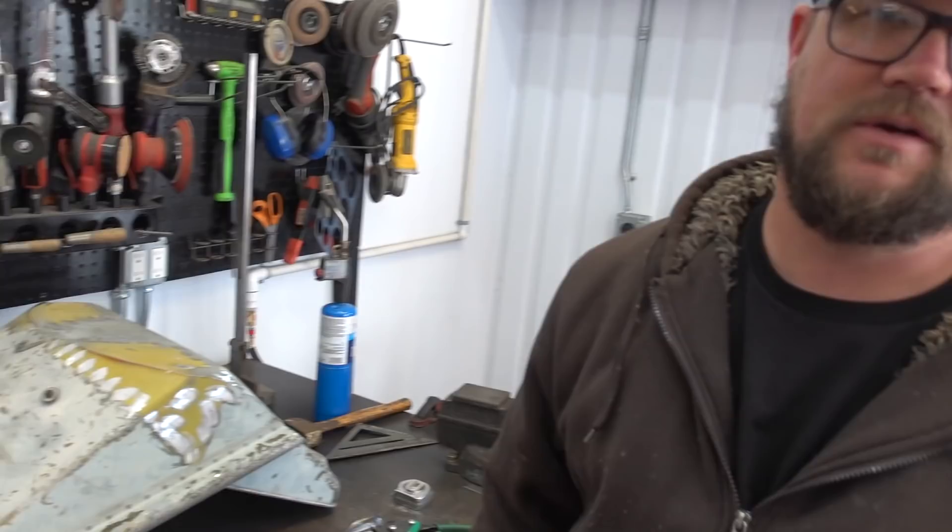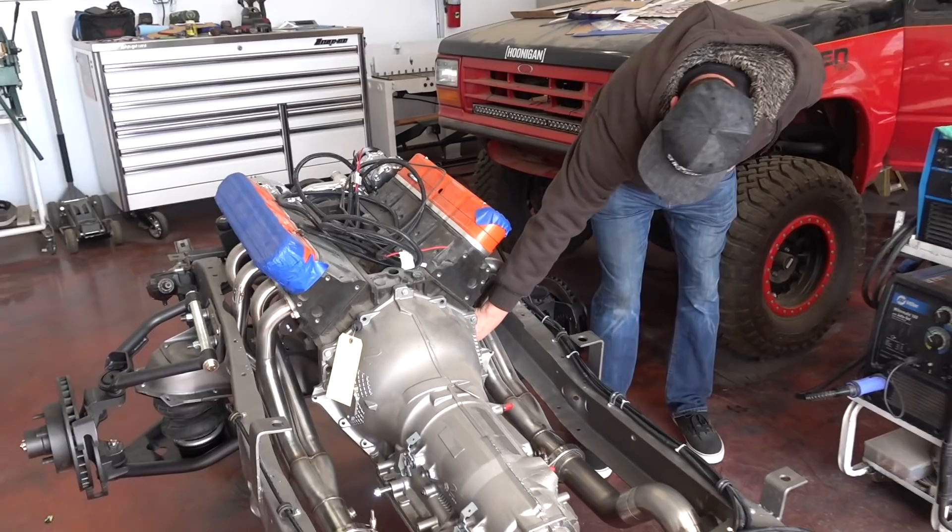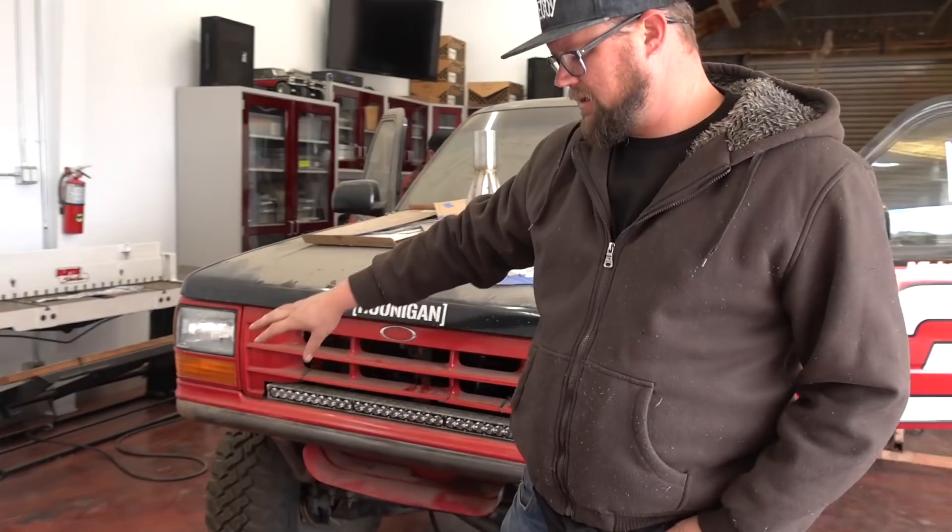You are back on airline fittings. You've got airlines to do, fuel lines to do, and you can start doing the transmission cooler lines. Those I think we're going to 90 here, come down this way, and then along like the oil pan to get it far enough away from the headers. Then you can leave them out from there.